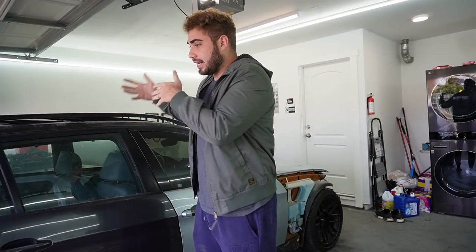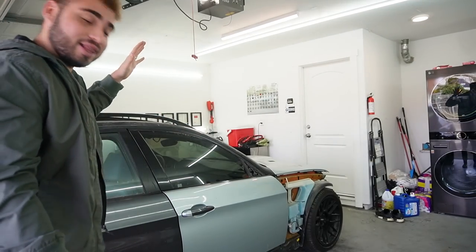Welcome back guys. We're back with the E91 M3. I'm super stoked to finally get this thing started. We got it started last video — it ran for a bit and then just didn't want to start anymore. We ran the codes, did everything we needed to do, and unfortunately it still didn't want to start. The codes pointed to the throttle actuators, the infamous issue with the E91 M3, specifically the S65 engine. S65s have two major issues: throttle actuators and rod bearings.